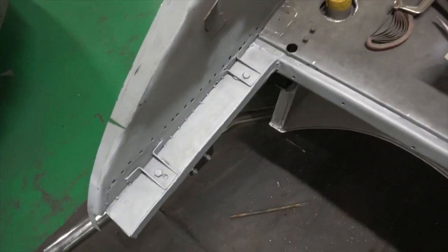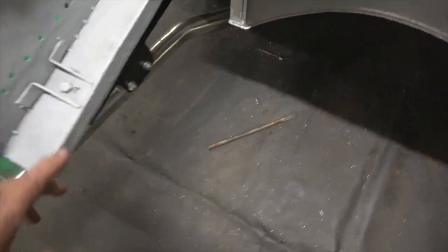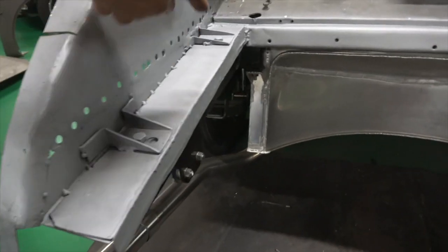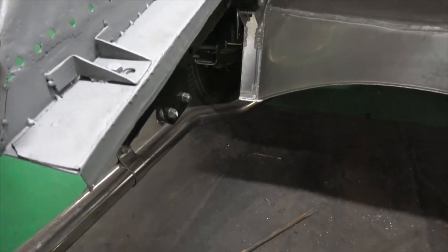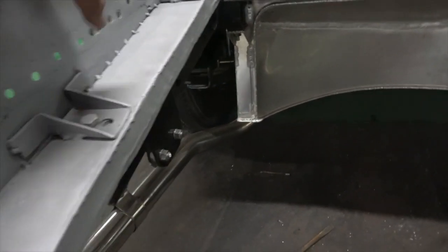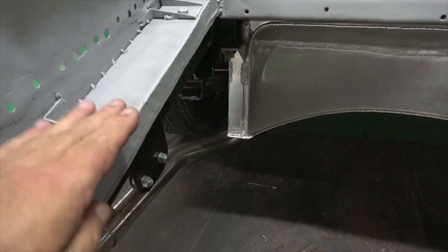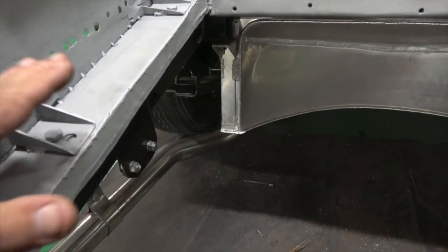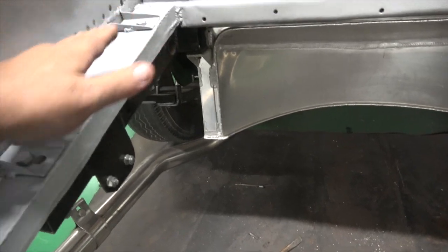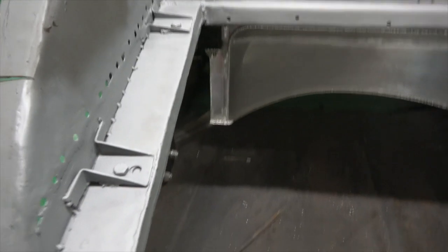You can see there's the two new bottom base panels on this side. Now these are made of two pieces of steel - you might be able to see it here on the edge - and then they've been welded all the way along, and then welded onto the car all along the edge. These tacks here are not holding anything; they're just holding the plate, stopping it from flicking up. Because the top of the boot plate comes across the top here at a very slight angle, and you'll see that when we get to that point.